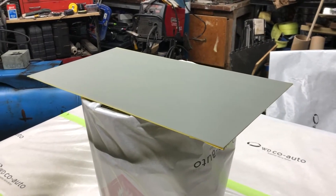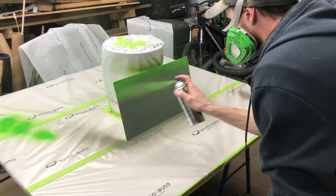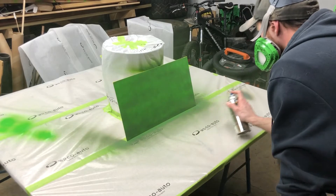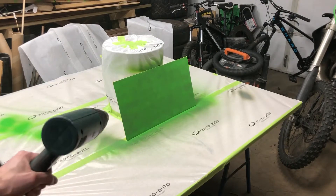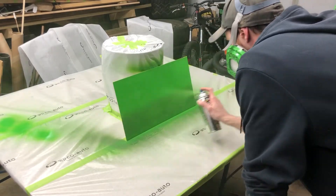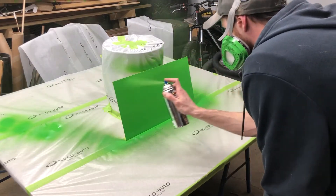As you can see, we've dried off to a really nice uniform surface. Time to throw on some paint. And look at that — not wearing safety glasses. While these single-part rattle cans don't contain any isocyanates, it's still good to wear safety glasses — it just keeps any of that overspray from getting in your eyes. Goggles are even better, fresh air mask is best. You can see I'm just touching the masking paper right next to where I was spraying to check if it has flashed off enough. If you touch your panel instead of the masking paper and it's still too wet, you can put a big fingerprint on it. So that's a neat little trick.